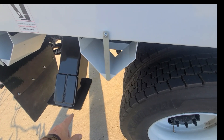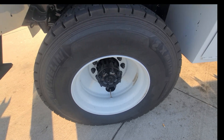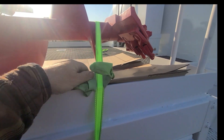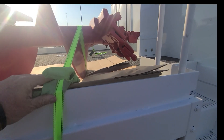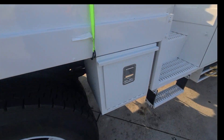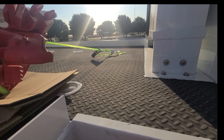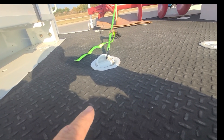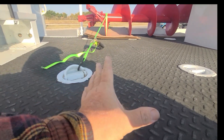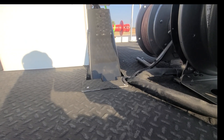Make sure your jacks are not coming down — some of these trucks will leak off, and if they are that's a problem. Check lug nuts and wheel seals again. We have a piece of equipment here — we want to make sure it's strapped down. I found some old gloves to protect from the edges when loosening straps. Checking doors again, still looking for leaks underneath, because your rear end could be leaking. On a used truck I picked up, I had loose nuts and big flat washers and pieces of cable — workers just threw them in. If any of those come off and hit a car, you're responsible.